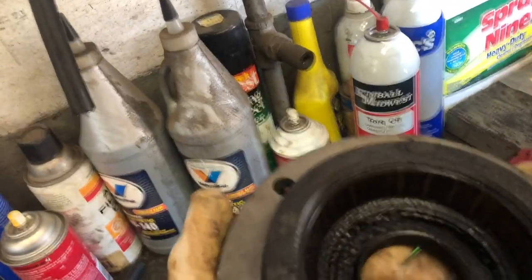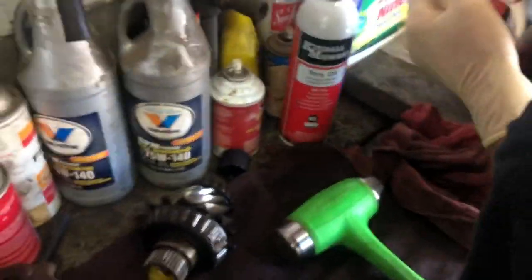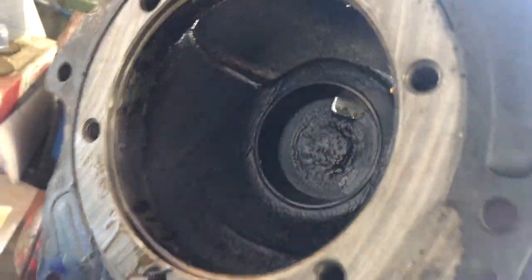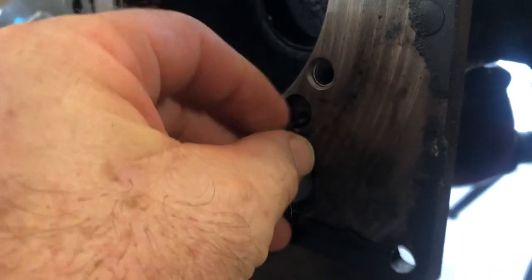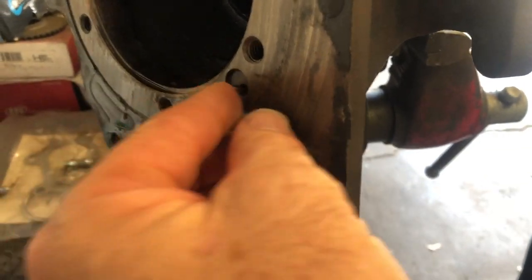I see zero shims in here. There's your pinion. Maybe there's zero shim — let's take this apart and see what's what. I don't see anything in there. So it looks like there's no shims in here, and maybe the pinion just sits where it sits. In here there's this little thing that maybe is for preventing some sort of foaming or cavitation of the oil, because that's an oiling hole. Until I hear differently, we're going to put that back in there. There's the o-ring for that, and then there's an o-ring that goes around here that we'll just reuse because it seems like it's in good enough shape.